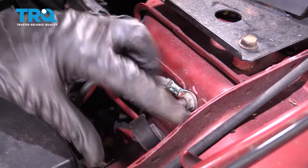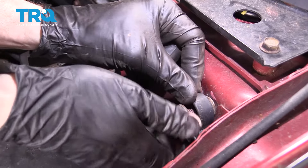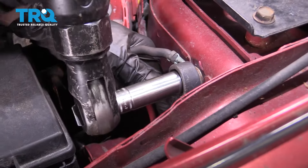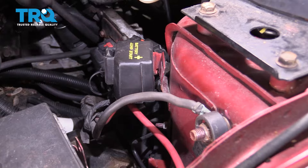Make sure the first wire is nice and tight, then connect in the second one, grab that nut, and cover it — it should hang up on there properly. Okay friends, we got our fuel pump back in there. We reconnected the fuse and the battery. Now hop in and try to start the vehicle. More than likely it won't start right off the bat — it's going to have a long crank, then get going. The reason is we drained all the fuel pressure from the fuel lines, so everything needs to make its way back up to the engine to get burnt in the combustion chamber. After that, take it for a road test and make sure you don't have any check engine lights. Thanks for watching.